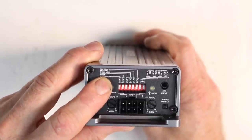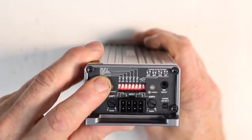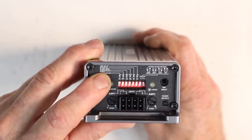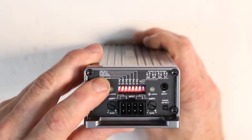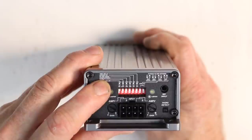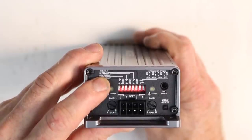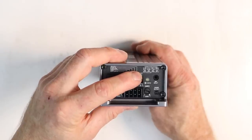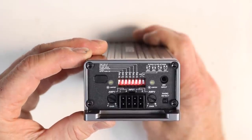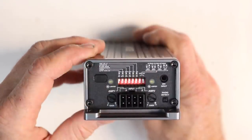Compression is used for high-volume listening — turn it on and off and see if it works for what you're trying to listen to. There's no right or wrong answer; default is off. Bi-amp mode is next and is used for when you're doing front stage only — tweeters or small mid-range in the dash and a mid-bass in the door. Default is off. Then you have KICKER EQ and time delay. If you want to experience what these do to your sound, they create a center image and make things sound up on the dash, very live-like. Default for both EQ and time delay is engaged. All these can be turned on and off after auto setup. The last two switches are your high-pass crossover, giving you either 60, 80, or 120 hertz. For the front tweeter or mid-range output when in bi-amped mode, it'll automatically sense what the crossover should be set to during auto setup. Make sure you do that before you start jamming.